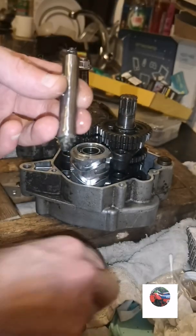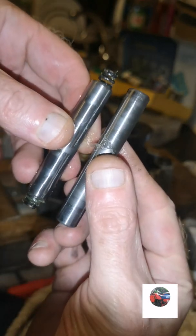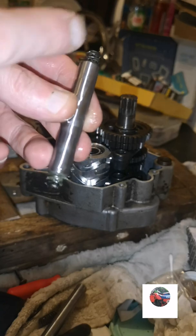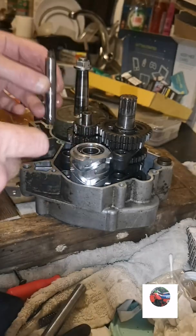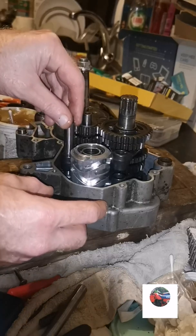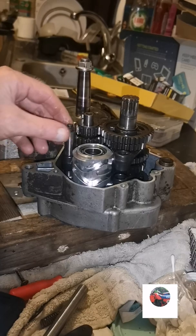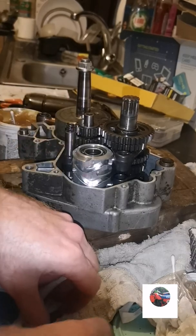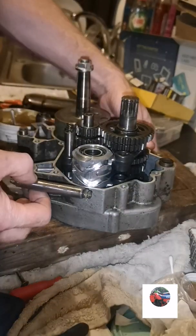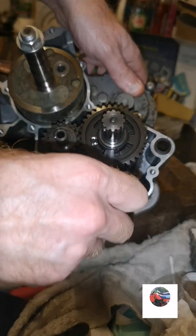So that's the short bar, the 2, all lubed up. That's the longer one. All lubed up, grease on each end of the springs to keep them in. And we'll just slide that into there now. That's that one in. Do the same on the other end. Just grease them 2 up, get them in the end, lube this and push this in. Just slide that one in, slide straight through that hole there, through both forks.